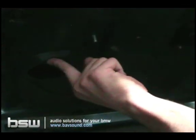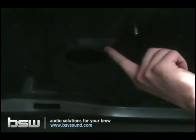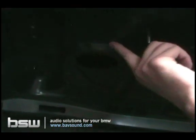We'll do it one piece at a time just for showing you guys. You can do it all at once. But the key areas to really get deadened are these low-hanging areas here. I don't know if you guys can still see, but we want here, here, here, and here, because that's where the enclosure is going to come in contact with the rear deck. So we take the sound deadening, and we just be careful because it's aluminum on one side, it's kind of sharp. We just want to roll it down nice and tight on that rear deck, like so. Roll out the little folds in it.